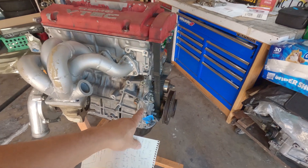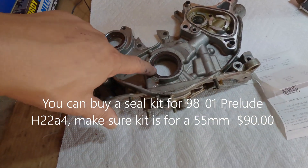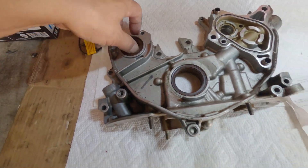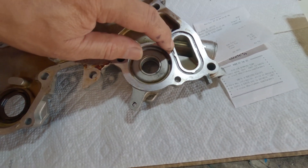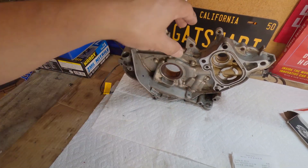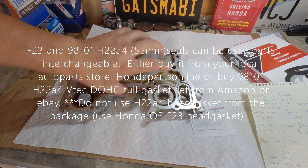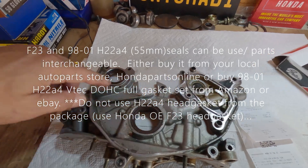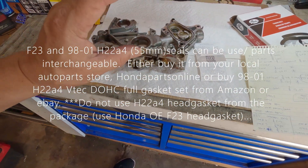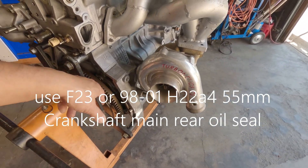Get a few items from Honda as well. On the oil pump — if you are using your balance shafts — you need a seal here and a seal there; that costs around eighteen dollars at the local auto parts store. On the oil pump alone you need about five seals total. I always buy those seals and o-rings from Honda because they last longer. You can also buy a seal pack through eBay — there's a whole lot of items in the package you'll never use, but some you will. The rear main seal costs about twenty dollars.